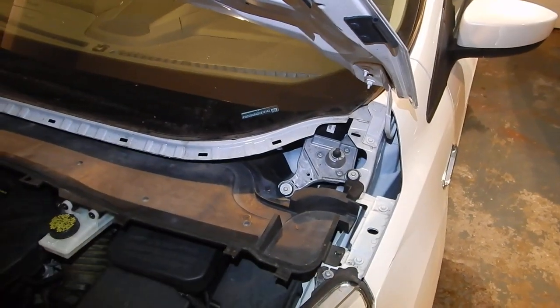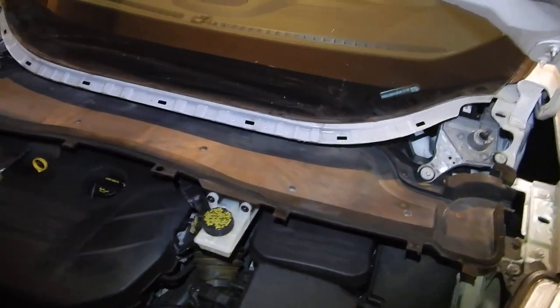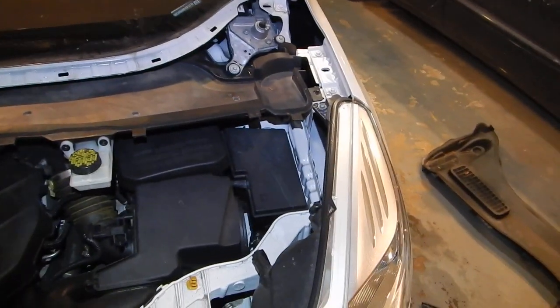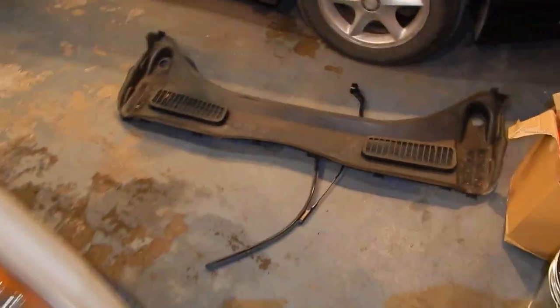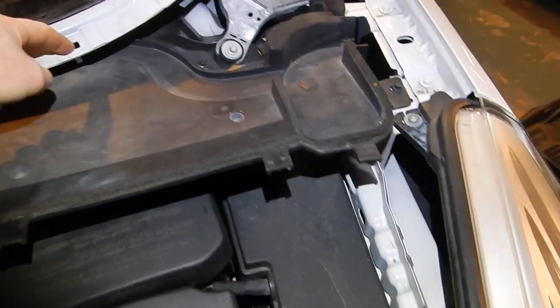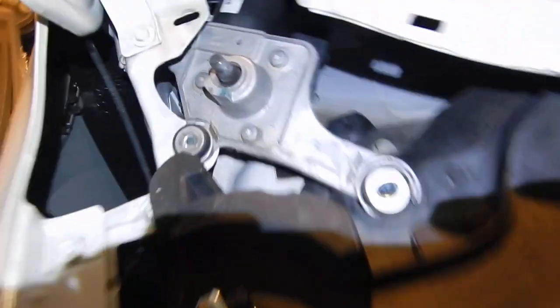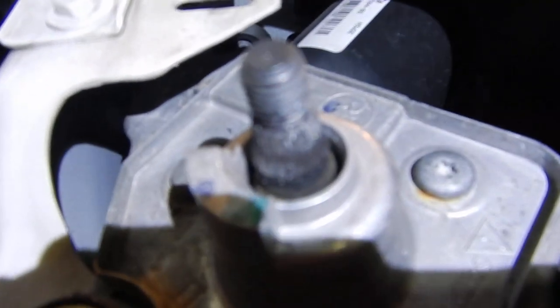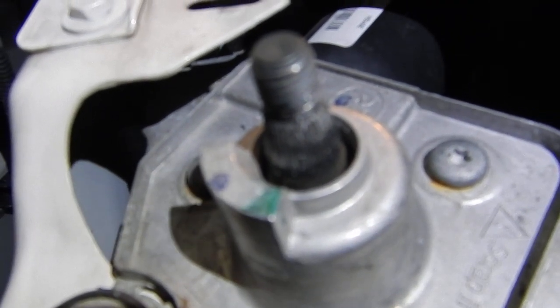What I'm doing today is I've ordered brand new windshield wiper motors and I'm going to replace them — fairly simple process. I'm not done yet but I just want to show what's going on here. You open up your hood and you've got this upper cowl that goes on here, and it's only held on by little metal clips that slip on here and then some tabs. You just take these clips off and that piece pulls straight up. I haven't taken this one out yet but I want to show you how the teeth are all stripped out — it's like a conical gear.